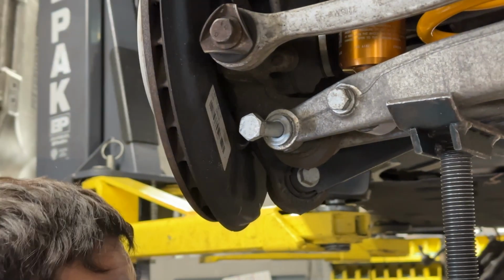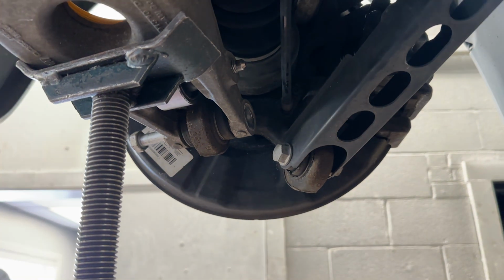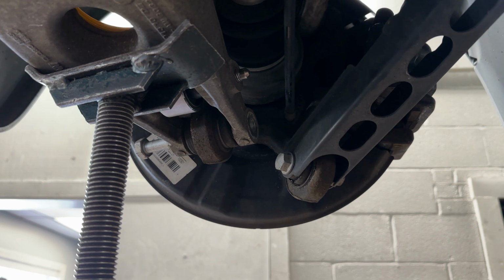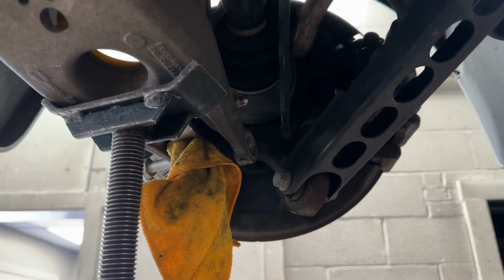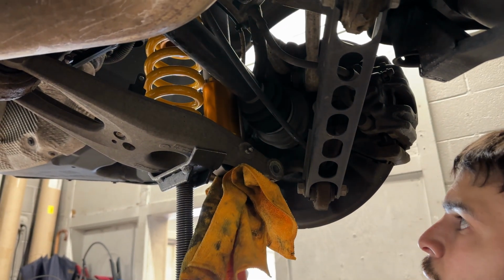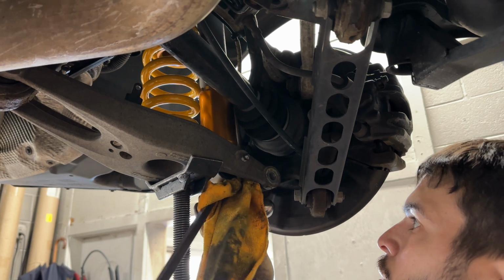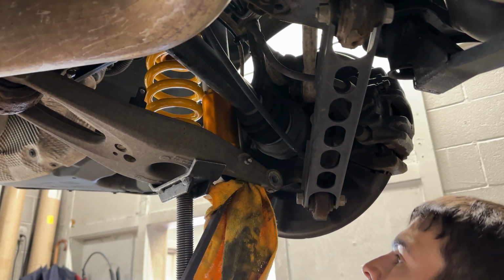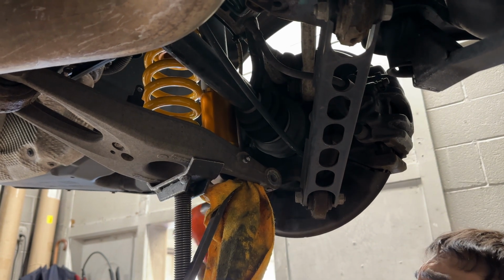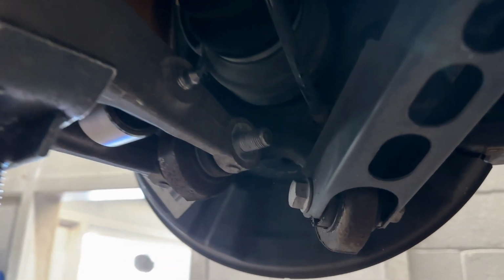So we cleared the first end, but now we have to clear the back end. If you look at the back end here, it's tough to see, but we're almost there. So we'll do the same thing. We'll jiggle it around, we'll flex it a little bit more, while also tapping on the head of the bolt so that we can help it find its way. Perfect. Here it is. And then you could throw your nut on it and finish preloading the suspension.